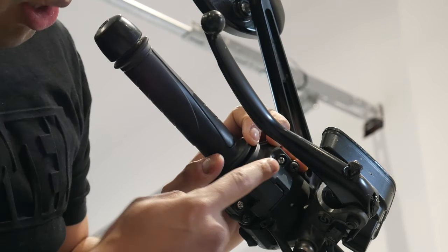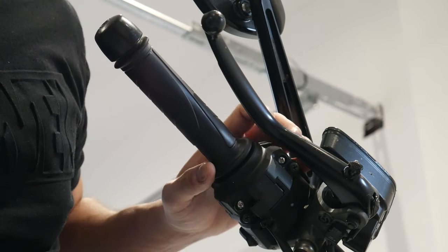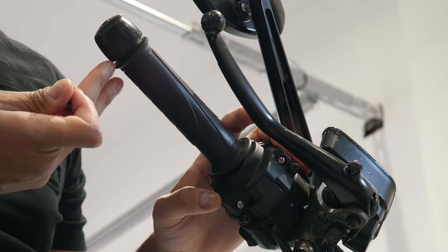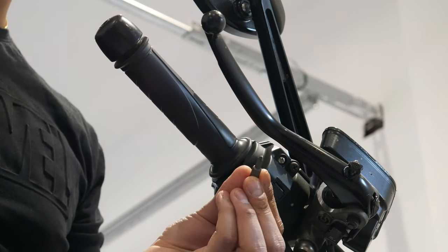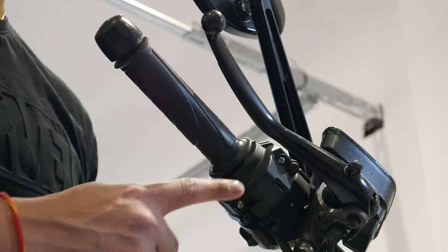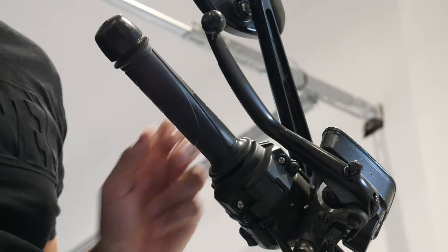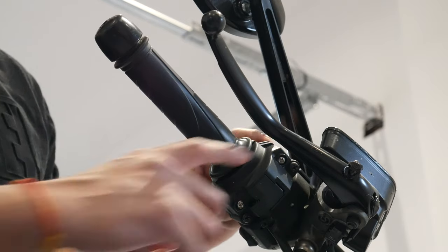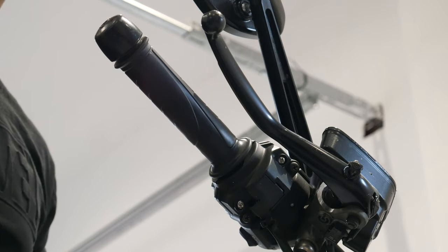It's quite straightforward. You've got four screws to undo: two of them are standard Phillips ones, and two are a weird triangular type. The kit includes a triangular screwdriver bit for those. We're going to undo these screws and the housing should just split apart - top from bottom - just enough to put in the spacers.